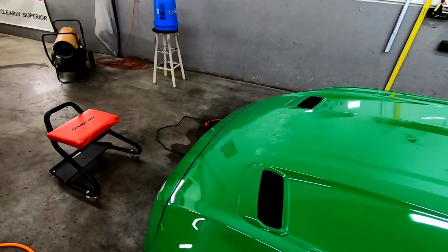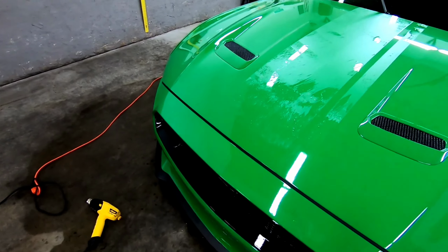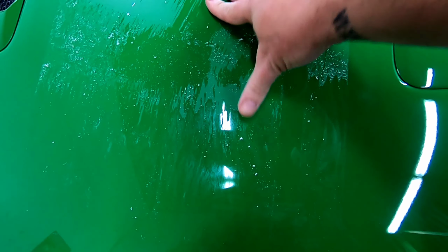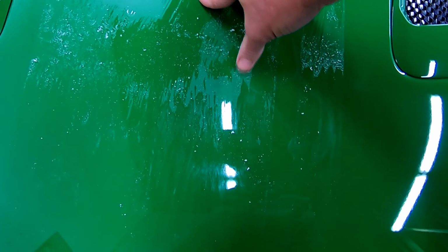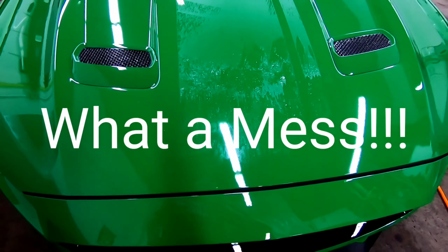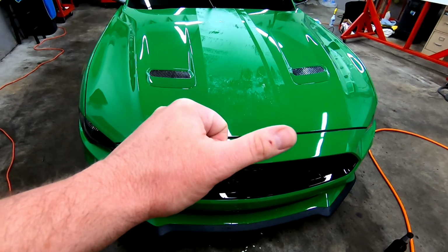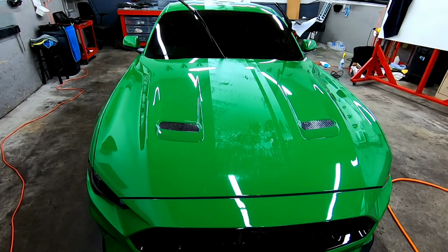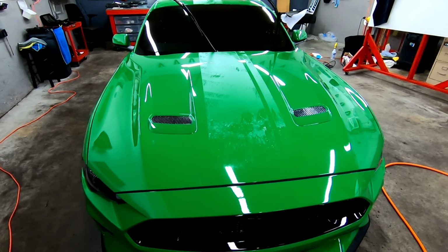Now what I have realized, and I remembered when I started doing this on the front, if you heat this and simply take your thumb and do this, this section's not heated, it's just residual heat. It comes up like that. And then I did another test section down through here with Goo Gone, and it got the residual in this section left over from this upper section. So long, painful. I'll have carpal tunnel before it's over with on my thumbs and fingers and joints, I'm sure. But as of now, that is the only thing that is working.